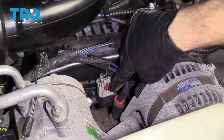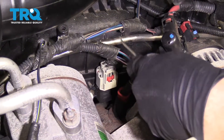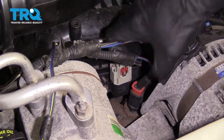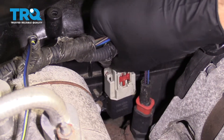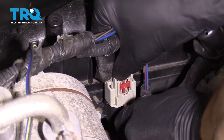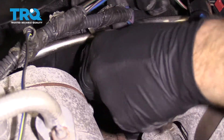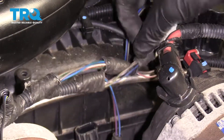First, we're going to lift up on this red tab, squeeze this, and remove our electrical connector. I'm going to take a small pocket screwdriver, put it under here, and lift up on that lock. It doesn't come up any further than that, so don't bother trying to break it. Squeeze this little button right here and then this electrical harness should want to lift up. I'll grab it with my screwdriver just to help it along — I don't want to tug on the wires. That looks great. Set it aside.